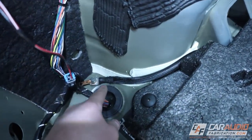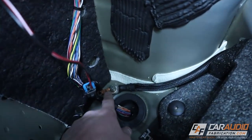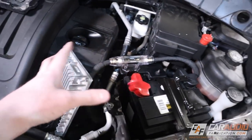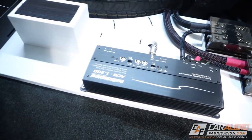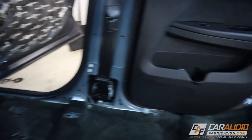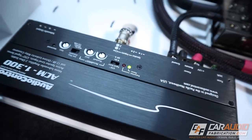I had a couple more things to finalize. I added this ground wire for the main distribution block that is on a factory ground here. And then now that everything is good to go with that, I added in the main fuse and bolted it in. Now I just need to add everything back above the battery in this vehicle. Before we completely reinstall the whole interior, we definitely want to do a power test to make sure that our amplifiers are powering up as they should. I've got everything reconnected — I'm going to go ahead and turn on the ignition here. Radio turns up and I heard the amplifier power up as well. So we are good to go.